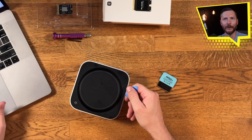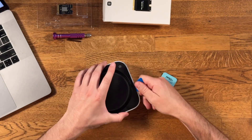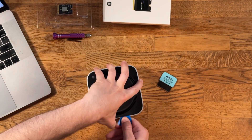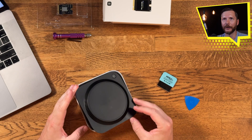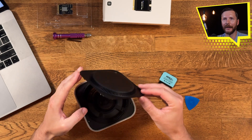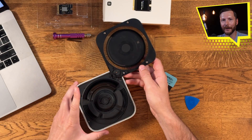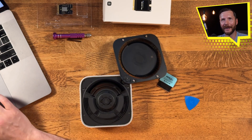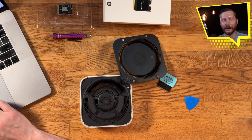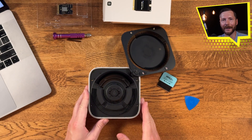You can see the clips are starting to come loose. I'm just twisting the plastic pick a little bit to get them to pop open. Now everything's starting to come free — I'm going to pop open the back plate and turn it over. You want to be careful because the power button is still attached via a little cable. The iFixit instructions tell you to unhook and remove that cable, but you don't actually need to do this for the whole process. I chose to leave it attached since it seemed pretty fragile — it was easier just to leave it there and work around it.